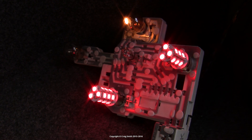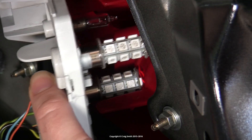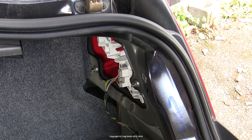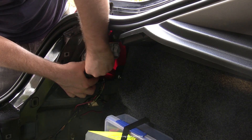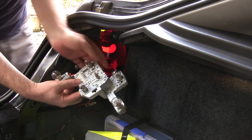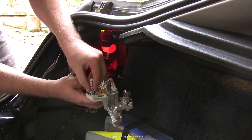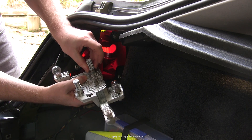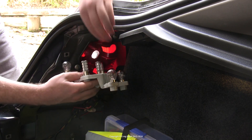Once the LED bulbs are in position in the cluster it's time to replace the cluster into the assembly. You do that just by guiding it home back into place, and you want to be very careful not to damage the bulbs as you do this. Then we will repeat this process on the other side where we need an additional two LED replacement bulbs — it's just an identical repeat of the other side. Make sure you replace the correct bulbs; it is difficult to do it wrong because the brake LED uses a different socket type.